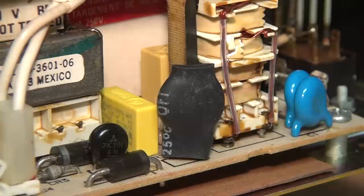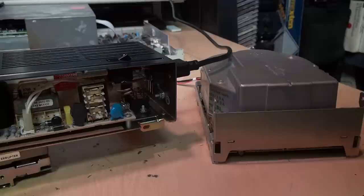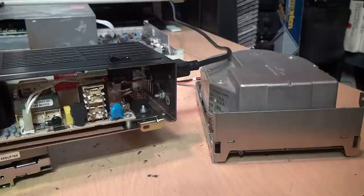The new capacitors are installed — they're all a bit smaller than the originals, and I don't expect them to last 37 years like the RIFAs did. Here I go plugging it in, and remember some of these capacitors are energized as soon as you plug it in, even if the power supply is not turned on yet. At least no explosions yet. I have it connected to this old MFM hard drive as a test load — let's see what happens.